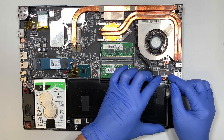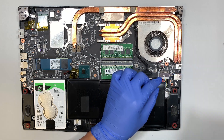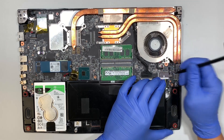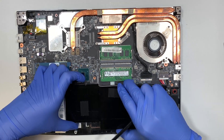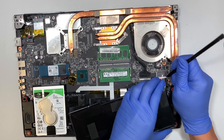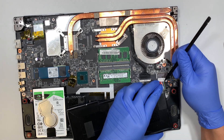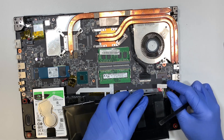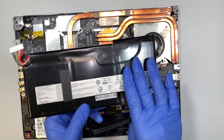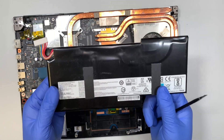The first thing I like to do is disconnect the battery. I'll use my fingernail to try to pull it down. If you have a hard time, leverage with a push and pull — while pulling the connector down, push down with a plastic prying tool as well. There's no clip; it just slides down to remove. My battery is still in good condition, but if your battery is swollen or you see a lump on the battery, it's time for a replacement.